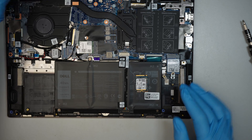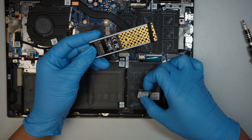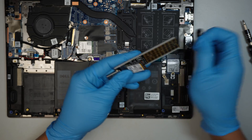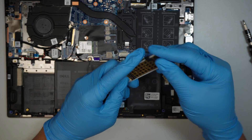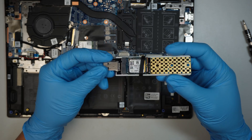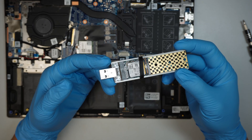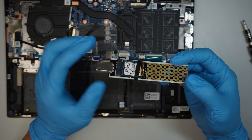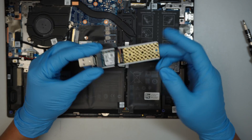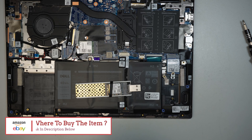I also wanted to point out this device — it's called a USB M.2 adapter. This allows you to recover your data. You can insert the old hard drive like such; there's a little rubber band that secures the M.2. Plug this into any computer and it acts like a USB thumb drive — you should be able to see your information given that the hard drive is still good. Check out the link in the description below where I'll link it to Amazon or eBay to buy this USB adapter as well as the replacement M.2 drive. Thanks for watching, until next time, bye now.